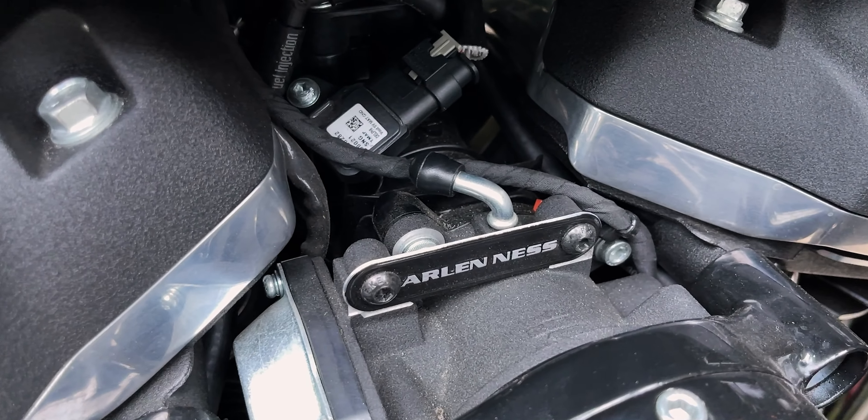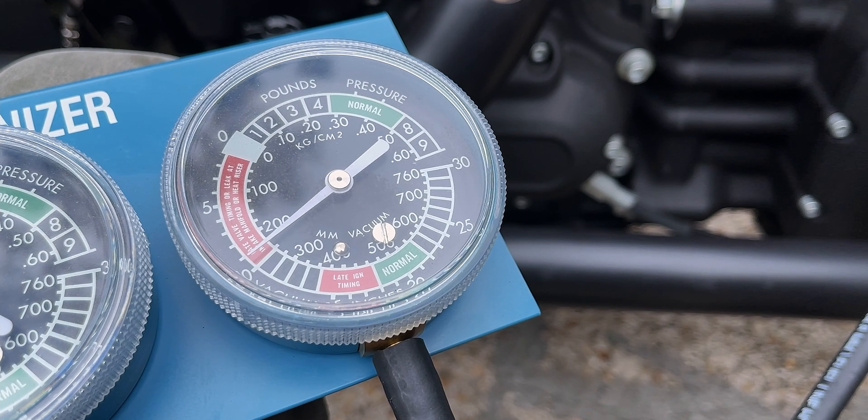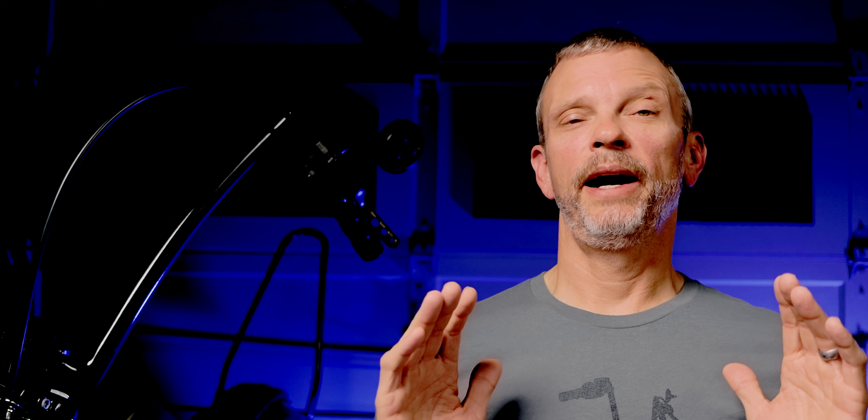As a reality check I did the plastic bag trick — taped a bag onto the end of the hose, cranked it up, and you can see it inflates that plastic bag like a balloon quite readily. So obviously there's positive pressure in the crankcase but no indication of any pulsation with momentary vacuum. The pressure is the most consistent aspect because it certainly fills that bag up quickly and stays inflated. Then I was curious about intake vacuum, so I found a capped-off hose barb on the intake itself, popped that cap off, put the vacuum gauge hose onto that barb, cranked it up, and there's an obvious vacuum on the intake.